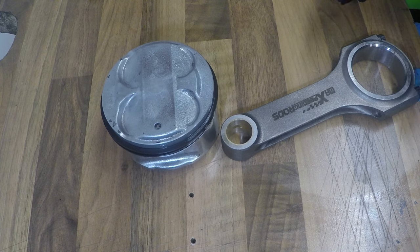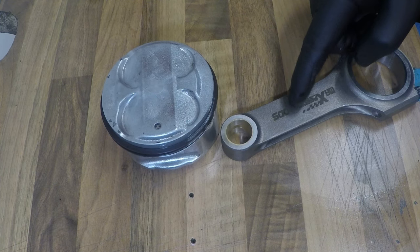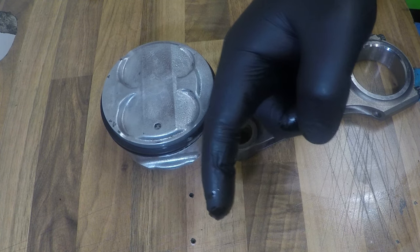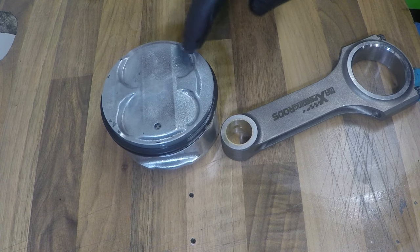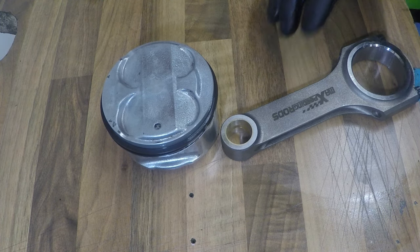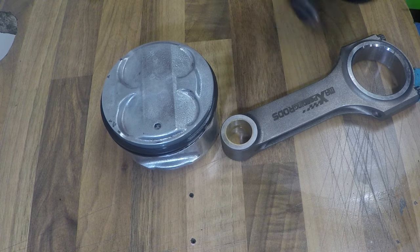Now that all the piston rings are on, it's time to marry up the piston with the rod. Now the pistons do have an orientation. They have a dot to indicate the front of the engine because they can't go around the other way, as the inlays for the valves are different, the intake are larger and the exhaust are smaller. The rod, however, doesn't have an orientation to go round, but I'm going to make sure the logo is facing the front,